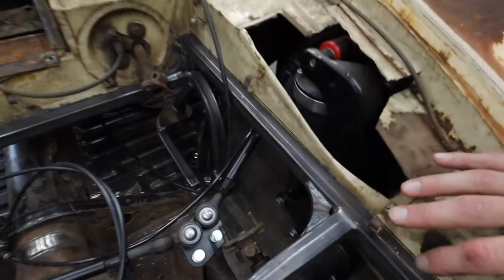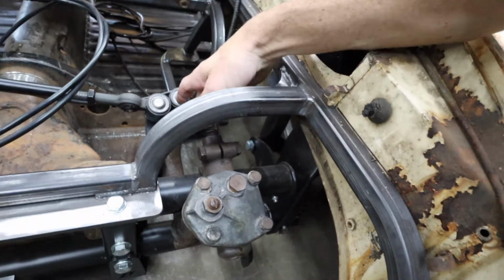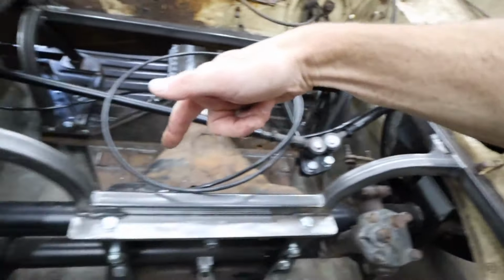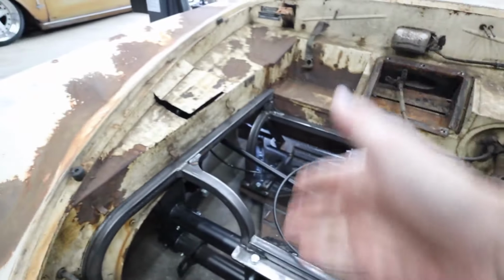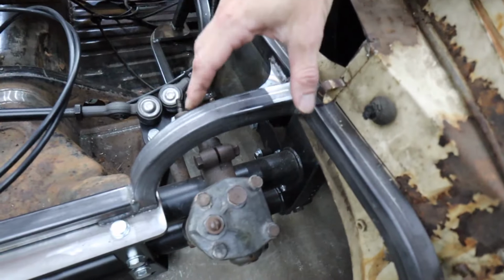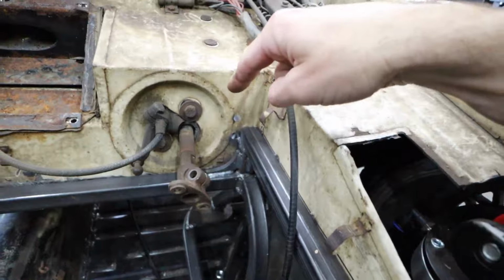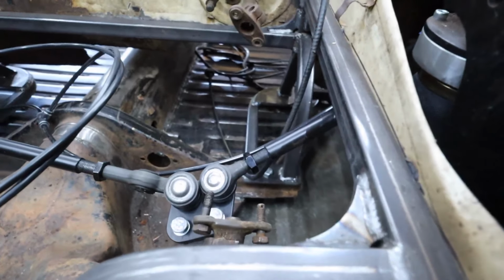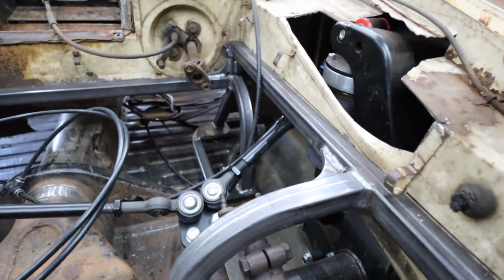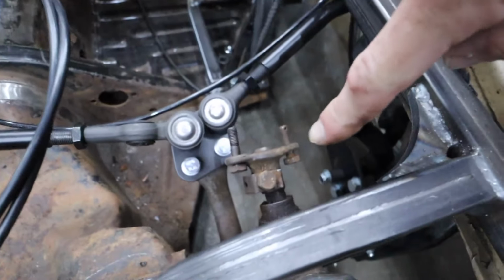Surprisingly and thankfully, even with the steering box on the EvaResto beam just kind of mocked up, we don't have our stabilizer on yet. We have to put our mount here for our stabilizer. I've got the track rods in and the wheels just kind of eyeballed straight. So where the box falls on the beam in relation to where the steering column comes out of the firewall on the 1000 SP, we are pretty lined up. It's really not bad. We're gonna extend the column from here to here.